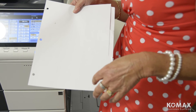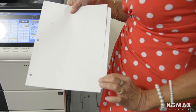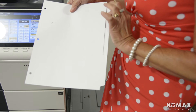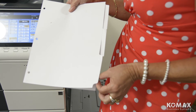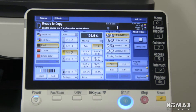This is what your tab paper is going to look like when you place it in the bypass. Normally your top tab is up here, but a reverse collated tab means that your first tab is actually your bottom tab. So when you put that in the copier, your tabs are going to be facing out, but make sure that your top tab is actually on the bottom. And when that prints, it's going to flip over and that will become your top tab. You have to run your tabs from the bypass — they won't run from any other tray.